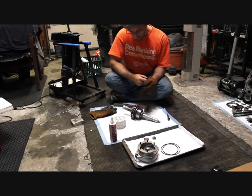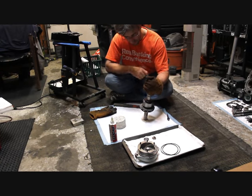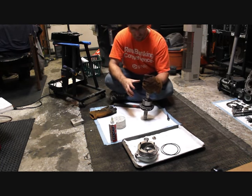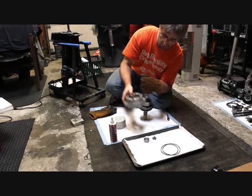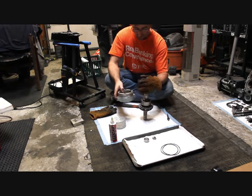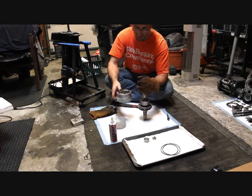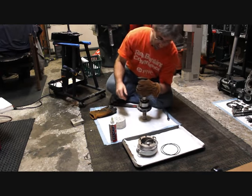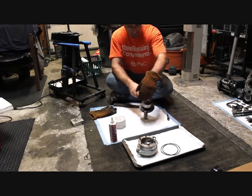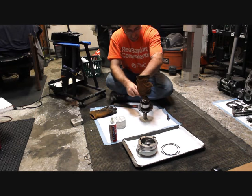From here we're going to put the whole thing back in the freezer. That was a little warm, even though it's on a frozen shaft — just to get the whole thing cooled down before we try to put it back into our case. Because we have tried in the past, while it's still warm, to let it cool a few minutes and slip it in — it did not want to go. So we'll slide it back into the freezer, come out, tap our nut again a couple times after everything contracts, then lock our castle down.